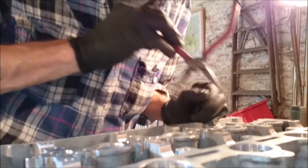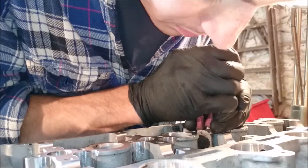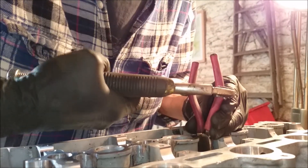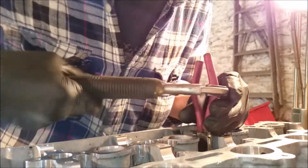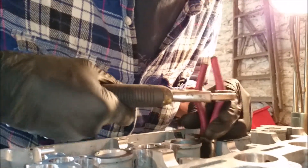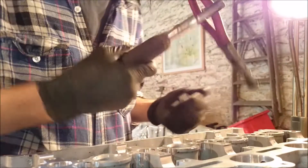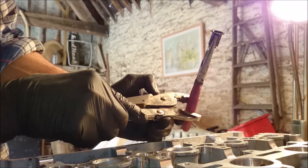Hopefully you can see this - what I'm doing is getting the pliers into a position where they're on a groove, with a big set of vice grips on the pliers, because the problem I was having was getting my fingers trapped when the pliers slipped off. The first thing you've got to do is make sure it's rotated to kind of break the seal, then check the pliers are still in place. Twist and pull gently - don't get your fingers in there because if it pops you're going to hurt yourself. There you go - that's my fangled tool to remove valve stem seals.